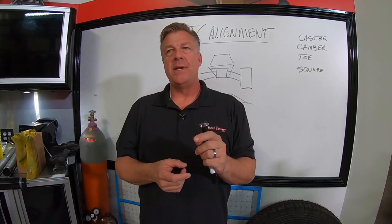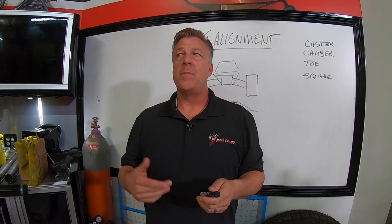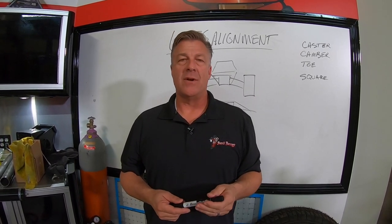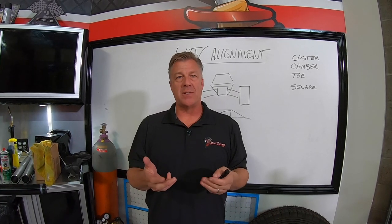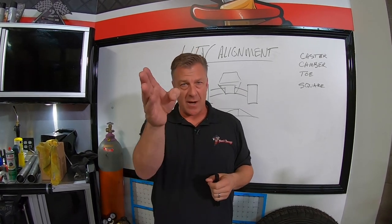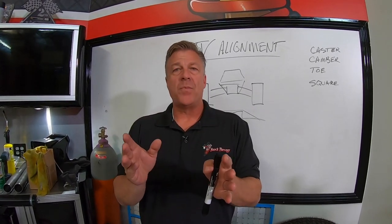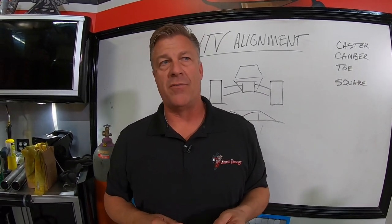4 to 5 degrees would be something that's 80, 90 mile an hour straightaways, a lot of them, graded roads, or even high speed whoops. You're going to want the thing to track perfectly straight through. In our race car, we can pretty much let go of the steering wheel at 80 miles an hour through 2-foot whoops, and it's going to track perfectly straight. When you hit the brakes and come into a corner, it'll drive perfectly into the corner, won't fight you.